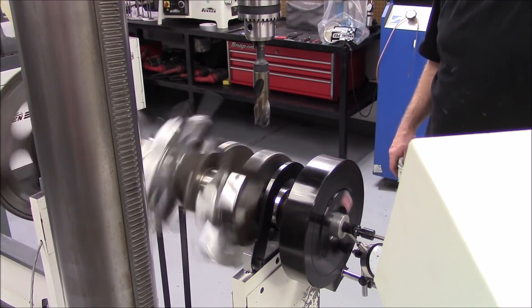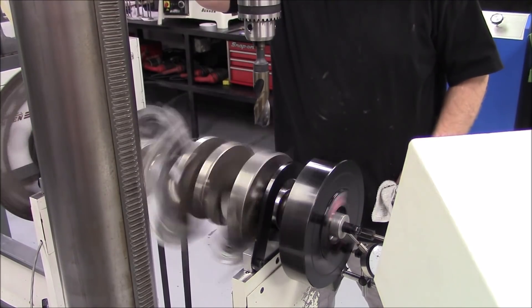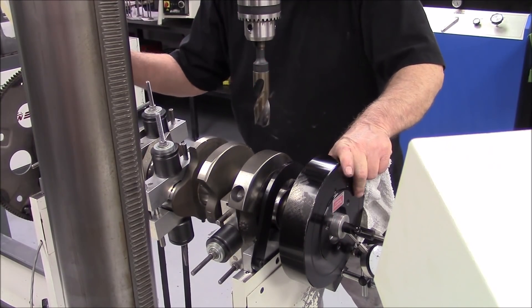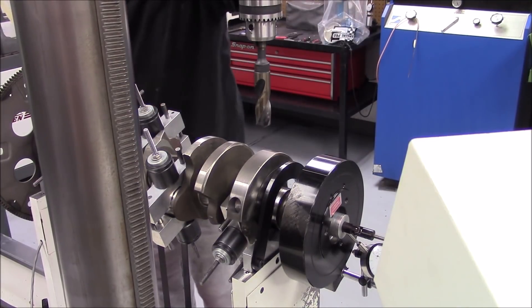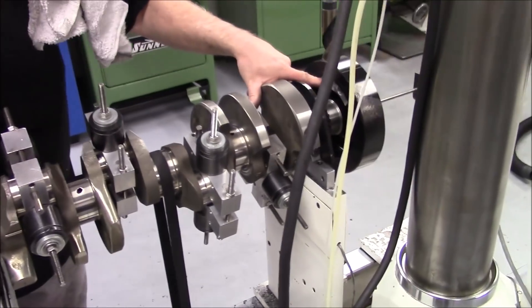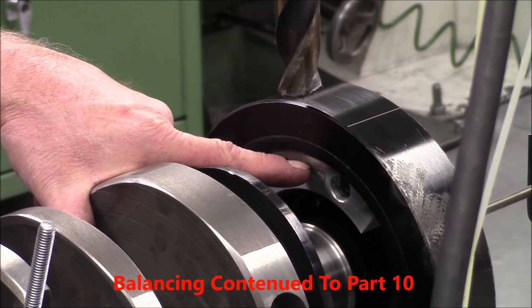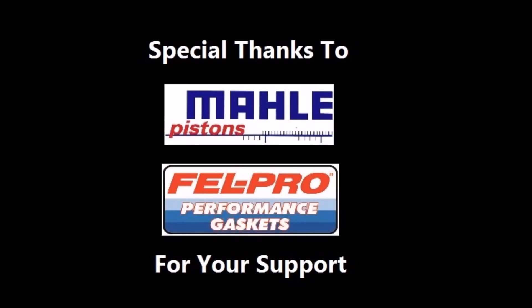I think that's going to put us where we want to be. Then we can take the rest of the weight out of the bolt-in counterweight and the harmonic balancer and get it lightened up even more. We went from 83 to 106 — wow, that really shifted it. We're right here, which is about dead center of our counterweight. See where this drill bit intersects this counterweight? We're dead center over this counterweight right here. We're going to take this counterweight off and trim it down to fine-tune it to the final weight.